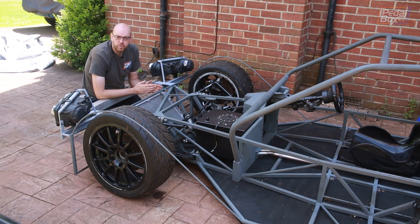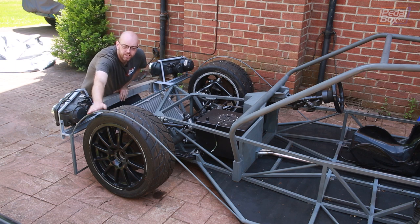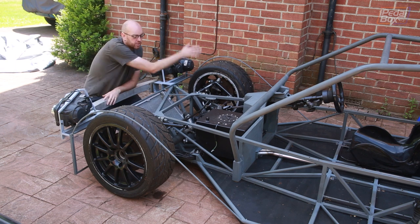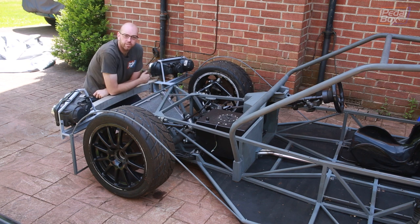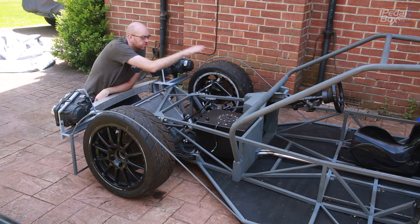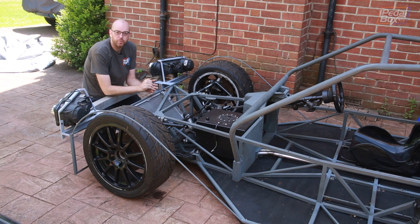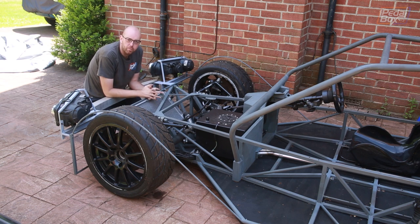This is something I've been looking forward to for quite a while, and I've been worrying about it in equal measure, because now I have to decide what the front of the car is going to look like. When I added these arches on, it's really exacerbated the problem of the rain well that collects water in the front of the car, and these arches aren't strong enough to support anything across the top. So I'm going to have to build some bodywork, or at least some framework for the bodywork, to try and hold it up a little bit better.